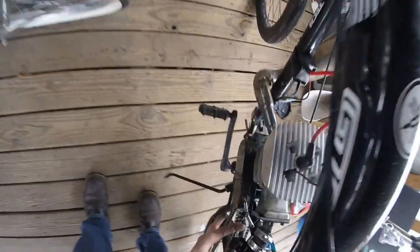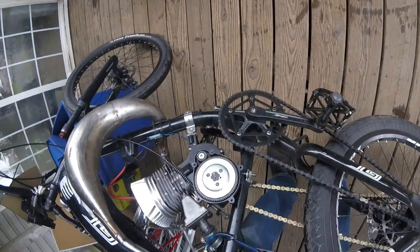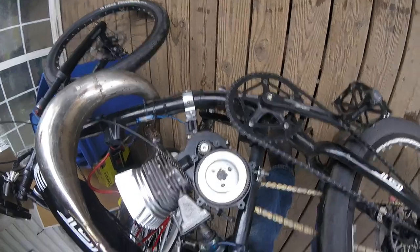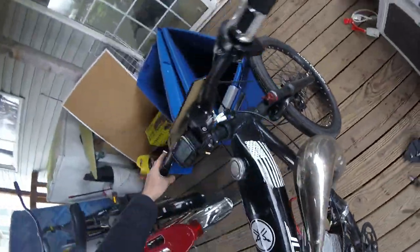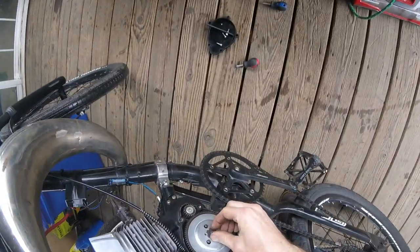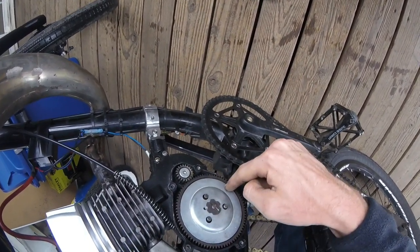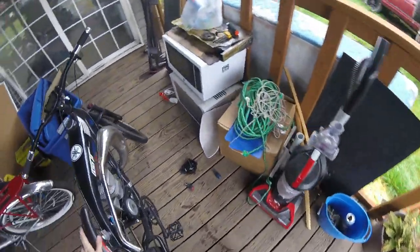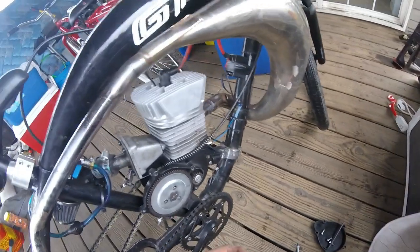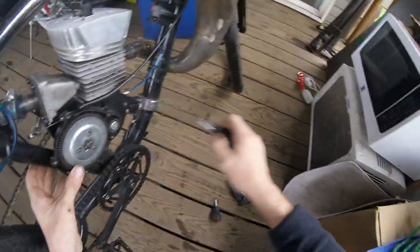We want it just backed off one notch - that's perfect. The way you tell it's perfect: lock it, the clutch arm still has a little bit of slop. If it loses its slop, watch - it turns the motor over. Now I have 100% clutch engagement and it's turning the motor over. Pull your clutch in, make sure it's lined up correctly, make sure it still spins. Grab your locking screw - this is an M4 by 0.70, a metric screw - and tighten it up.